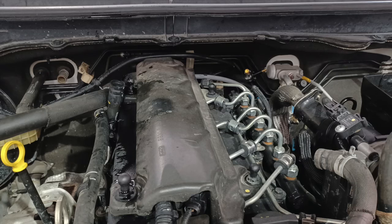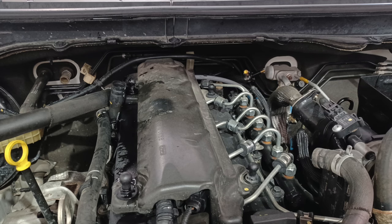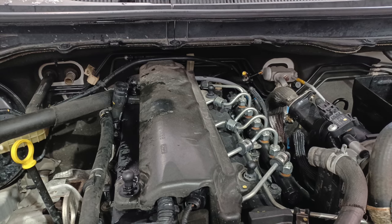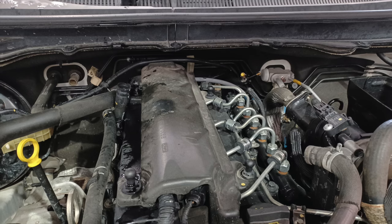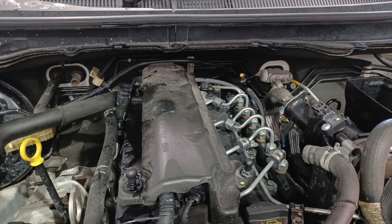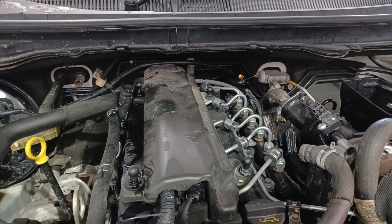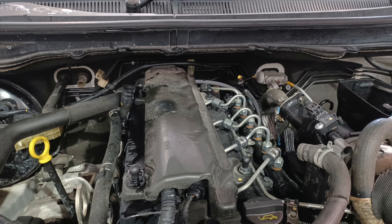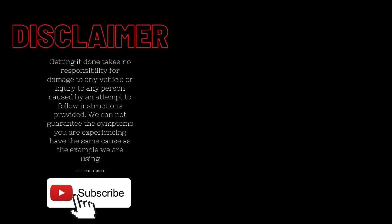So much easier than it looks from the outset — gearbox does not need to come out. With the extension and universal you can get those bolts off the valve end, fairly easy getting in once the exhaust manifold cover is off. To get into the manifold end bolts, just from the end there, then work it out around that left hand end once you get the valve assembly out of the way. One of those things that looks really horrible, but it's actually not that bad once you dive into it. I hope that has helped you out today — don't forget to click a like and subscribe for more real tips from real mechanics.